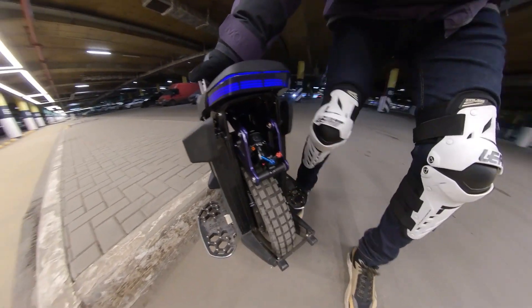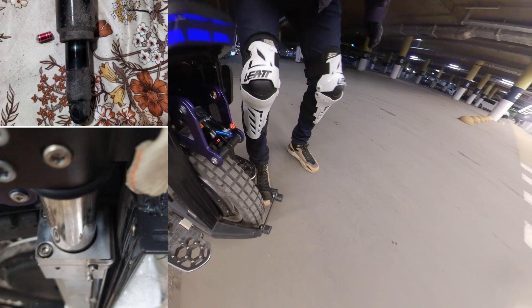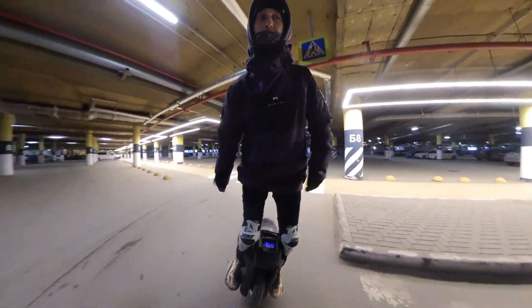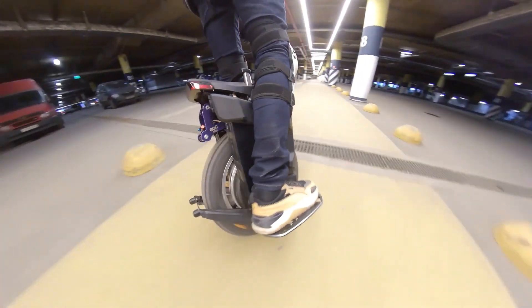As a result, I removed this mudguard. Also, in the attached photo you can see that there is a big gap between the graphite ring and slider, which also gives its own sounds when the whole system is running. The wheel was not in the highest quality service and we didn't rebuild it completely — we only changed the links with the axles and shock absorbers.